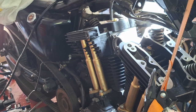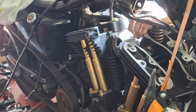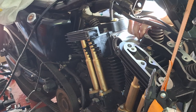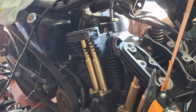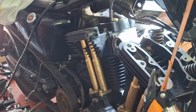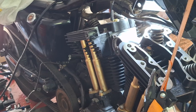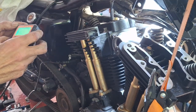If you don't have an angle finder, you can use your backing plate on your carb to do it — put everything in there and just line it up till it's flat. I have an angle finder so it's just easier to use that than to put a carb in there with a backing plate and have to take everything back off again. That's that side, let's check it again just to make sure.